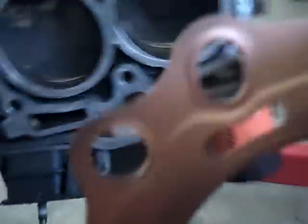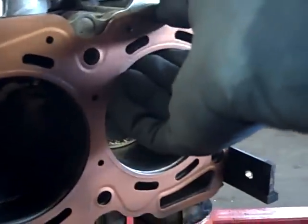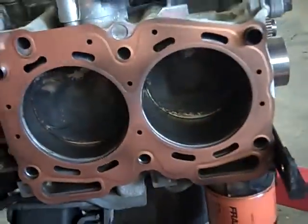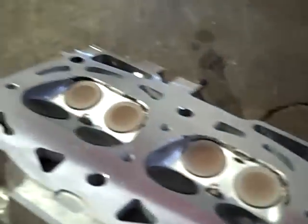It doesn't matter which head gasket you use for which side. What matters is that little oval right there needs to go to the top part — so line that up. Put it on your alignment dowels; it'll just hang there for you. Then put your cylinder head on. This one had to be decked — it was pretty severely warped. Check your valves and make sure that they seat well.